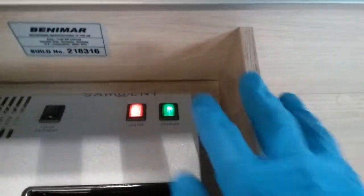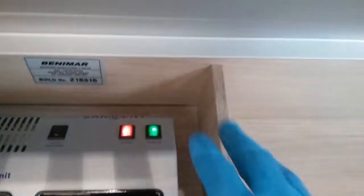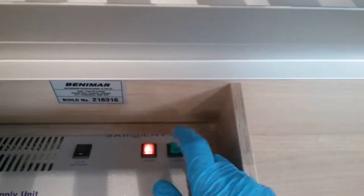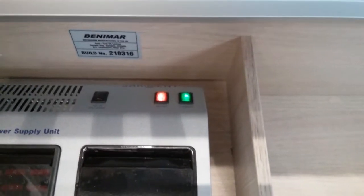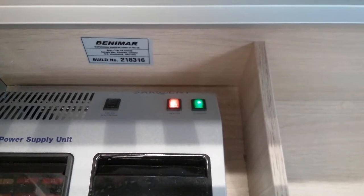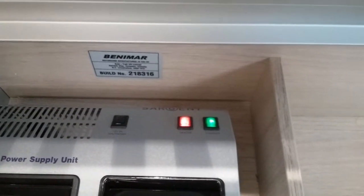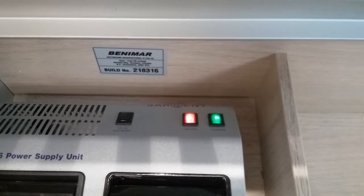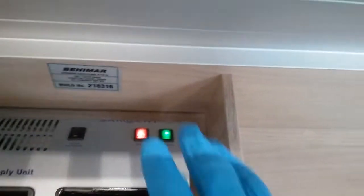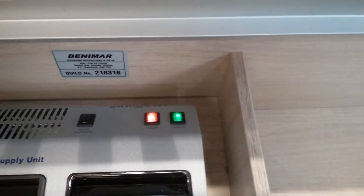Along the top here we have 2 isolator buttons for components that use main supply. So we have the green one here which is for the battery charger. Can be turned off just like so, but we want this turned on because we want to be able to charge the batteries when the van is hooked up to mains electricity. And then the amber one just here is for the heating and hot water, and again, if we turn this off, we will not be able to then heat or produce hot water on main supply. So really, again, these are more for maintenance, so can really be left on.